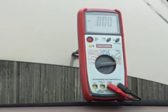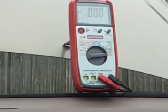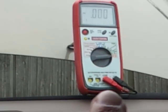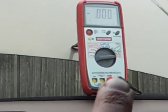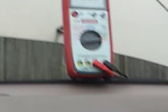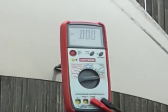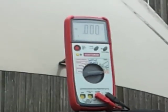This test is a way to rule that out. You connect your digital multimeter — your DVOM — set it to DC volts. For the first test, connect the common (negative) lead to your negative lead and to the alternator case. Some multimeters have a strap that connects to the motor — connect it on that strap.